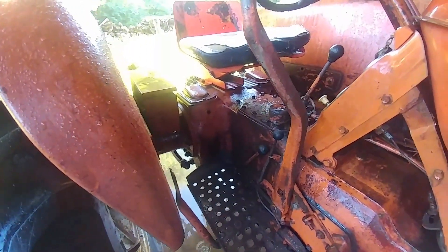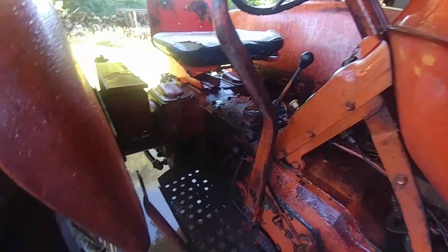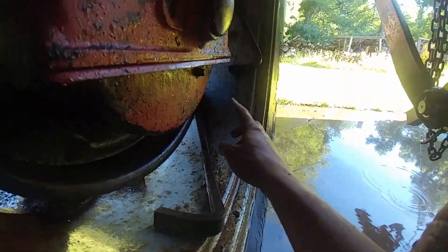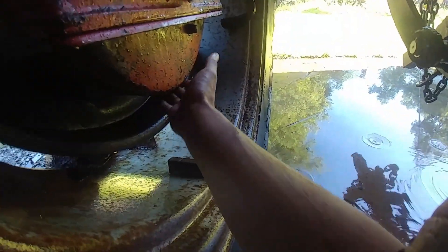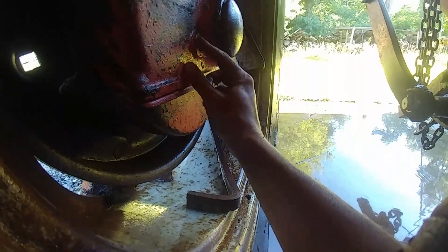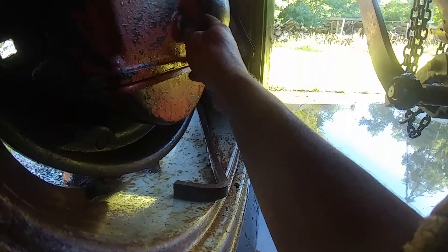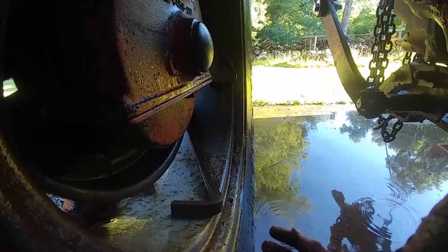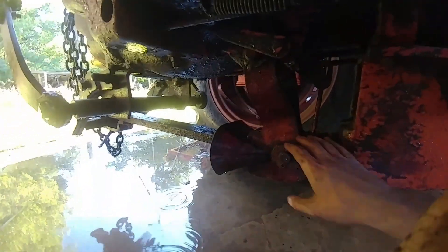There's really no way around it unless I put a plastic bag around the shifter and stuff. But apparently these final drives — there's a bolt hole, so there's this bolt right there that must be a fill or a drain or something. There's no drain on this thing, so I'm not entirely sure. I guess there's supposed to be a bolt in here and that is full of dirt and stuff. So at some point I'll probably pull these bottom covers off, clean the whole thing, and fill her back up with gear oil.